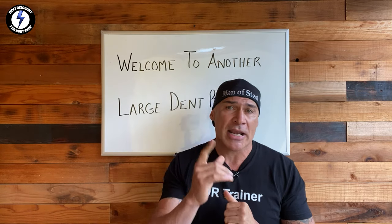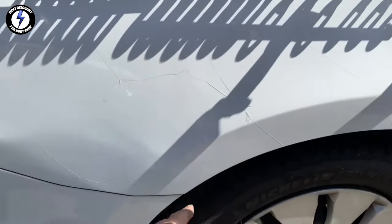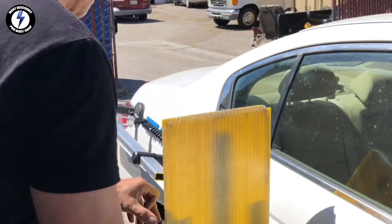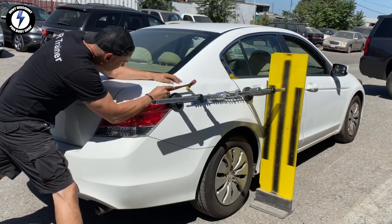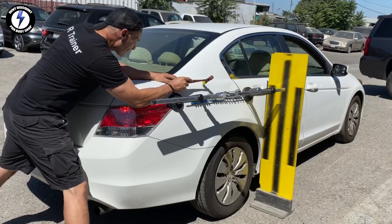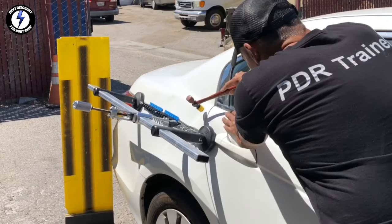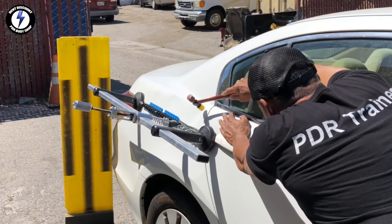Let's reassess the damage. You can see the remaining crowns and low spots. Moving on to my second technique in this repair — I'm going to do some panel beating from the outside using my blending hammer, gently hitting and lightly touching the crowns. Tip number three: don't hit too hard, it will create more work resulting in a longer repair time. I'm releasing tension, moving my tension hook closer to the door, and blending the crowns into the dents and into the rest of the panel.